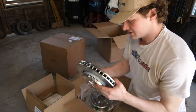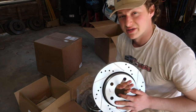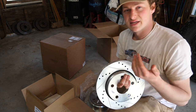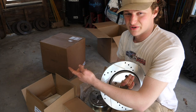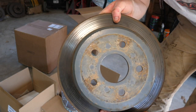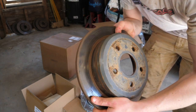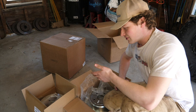Talking a little more about the specifics of these rotors — they have much improved airflow and cooling. There's a big open slit in the middle of the front rotors, and that's actually a huge airflow increase for cooling. Being drilled and slotted will also keep temperatures down, provide faster stops, and these slots help remove debris that would damage traditional rotors and pads. This is the rotor from the passenger rear and you can see tons of scoring, scratching, and uneven wear — that's what happens on an off-road vehicle when debris collects on the rotor or pads.